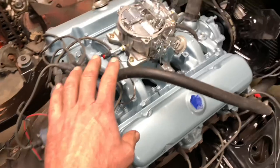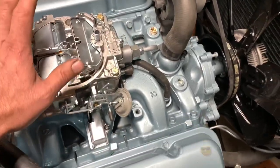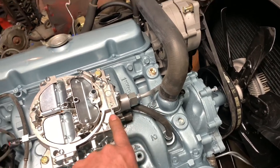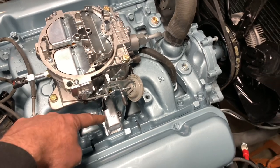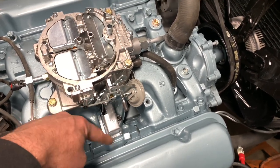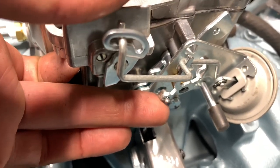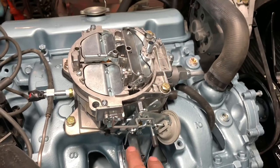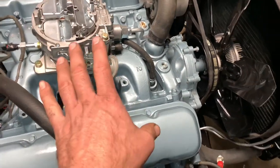Now the goal today is a test fire. You'll see here a carburetor - I bought this on the internet and it's a recreation of a 1968 Quadrajet that would have come on the car from the factory. I bought this fuel line pre-bent for a 1968 V8 and it fits phenomenally even with this carburetor. The carburetor comes as a nice assembly but doesn't include the heat riser style choke that uses a bi-metal coil. I salvaged one off of a two-barrel - the two-barrel coils pull down as they heat up, not push up, but you can flip the coil over and make it work backwards. I bent my own custom link, so it's a bit of an experiment to save 40 bucks - 40 bucks is 40 bucks.